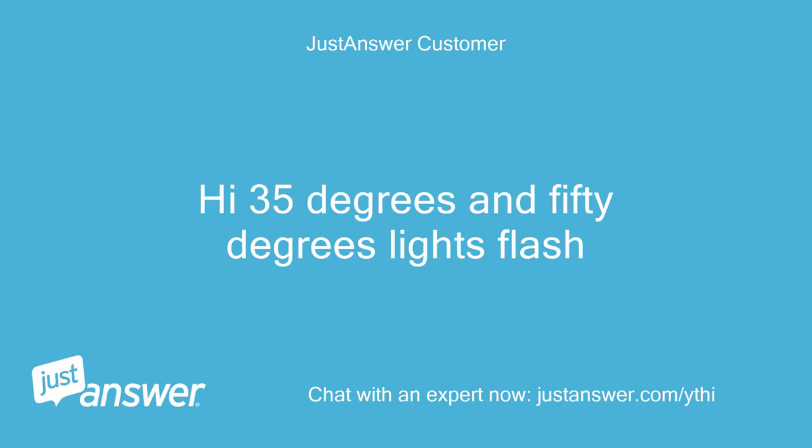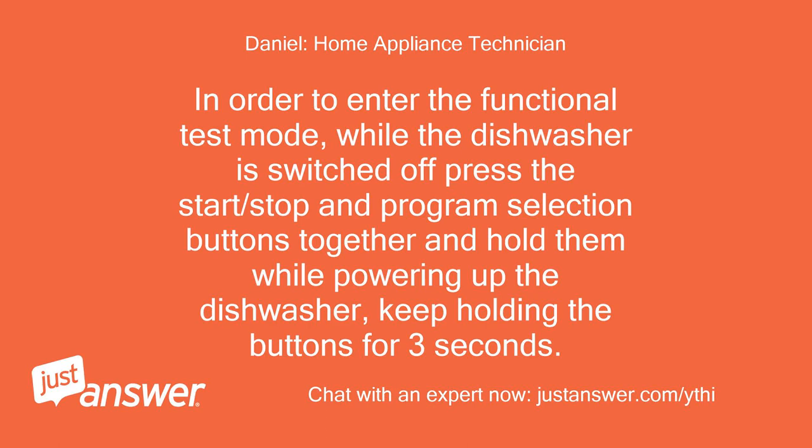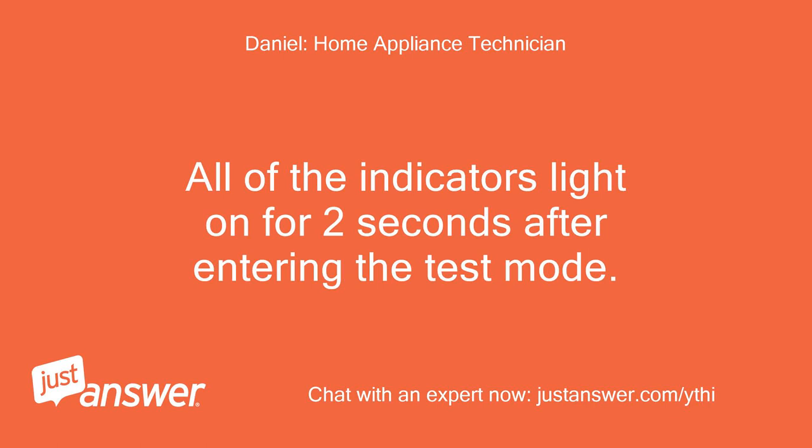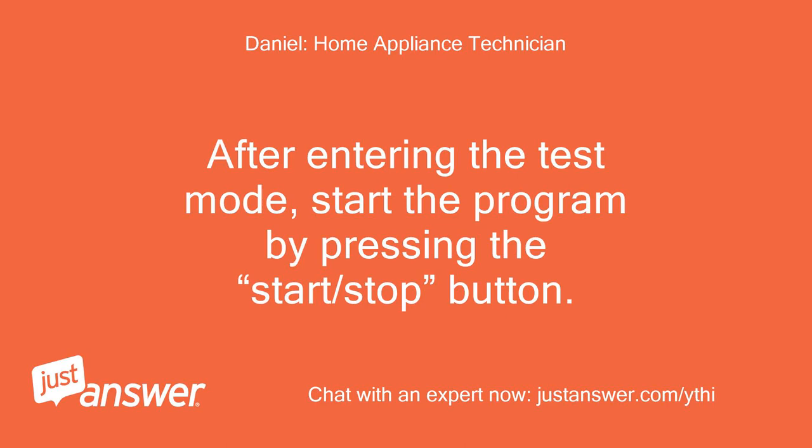Okay, try this and see what happens, as it's a test cycle for the dishwasher. In order to enter the functional test mode, while the dishwasher is switched off, press the start/stop and program selection buttons together and hold them while powering up the dishwasher. Keep holding the buttons for 3 seconds. All of the indicators light on for 2 seconds after entering the test mode. Program indicator lights will flash if there are any faults held within the memory of the control system. After entering the test mode, start the program by pressing the start/stop button.